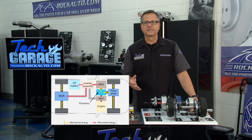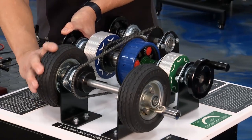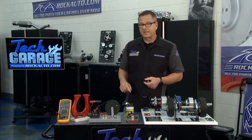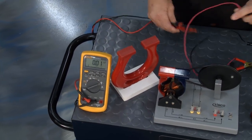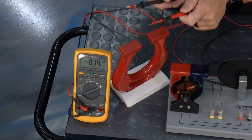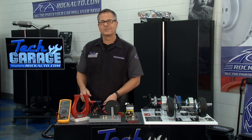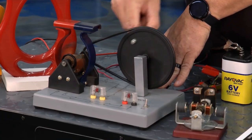You also have another thing called regenerative braking. Looking at this last graphic — I can come over here, hold the ICE motor. What happens is when you start to slow down, you can see it actually pulling. I'm pulling the motor generators, reversing that polarity, and charging it. Well, how does that work? I can show you — we can actually make electricity, which is really cool. I've got the meter set up and a piece of wire right here. When I cut that magnetic field, I'm actually going to induce a voltage into it — watch the meter. As I go up and down, I'm actually inducing that voltage. What's happening with the car? The wheels start to slow down, we reverse the polarities, and we actually start to make that motor into a generator — just like those old starters used to be big generators. Counter-electromotive force back up, charging the batteries. If I spin it, I'm recharging the system.